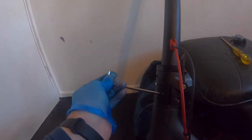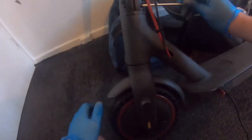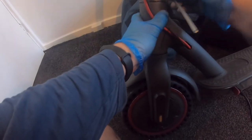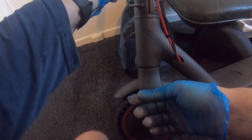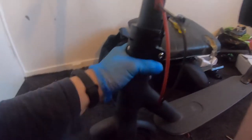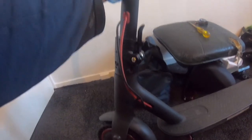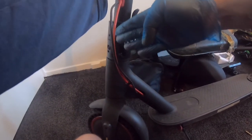No wobbliness — that's perfect. When you feel no wobbliness, the last part is you always do these two side bolts last. Let's tighten those up evenly. I've been using the speed hack on this scooter for two years now and it's still running as good as the day I bought it. Same goes for the M365 Pro 2 — been using the speed hack on that for nearly a year and it's still running perfect. No wobble at all — that was pretty quick, didn't take me too long. Very easy when you put all the parts in a line.